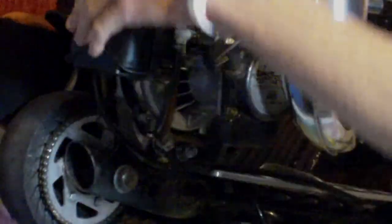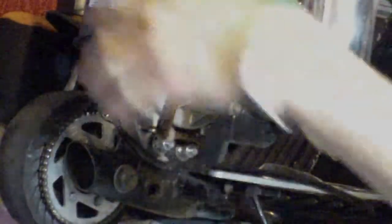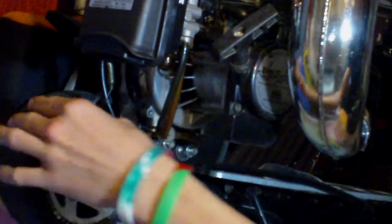So you want to move the engine not too far up, because you don't want the chain to be too tight — you're going to end up stretching the chain and popping it off. You want it so it can move just a tad bit, like a wiggle a little bit.